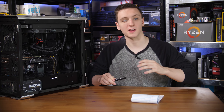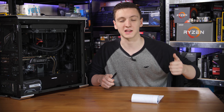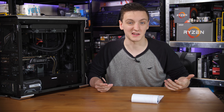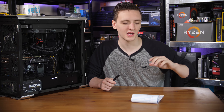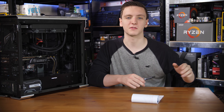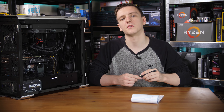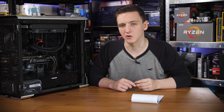You may know the AMD Ryzen chipset fairly well and wonder why bother with B450 when a B350 will work just fine — it has the same socket, and as long as it's had a BIOS update, it's still perfectly compatible. Well, generally speaking, you don't really need to be bothered. If you can pick up a B350 board that suits your needs and runs your chip fine, go for it — it's still a perfectly functional board. Some older or cheaper B350 boards did have cheap VRM solutions, so you might not get a 2700X at full boost clock, but a 2600 or 2600X should be fine on basically any board.